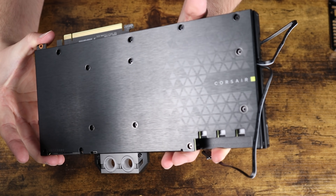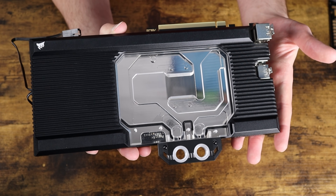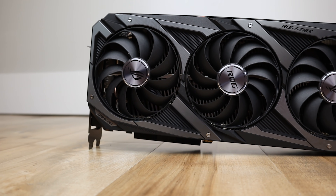If we take a look at the back of the GPU cooler, while it does have some thermal pads that make contact with the VRM on the RTX 3090, the problem is what we're looking at here is just a simple metal piece — it's really not going to be very effective at dissipating all that heat. The GDDR6X on the RTX 3090 can get very hot because it's right on top of more memory that could be soaking in that heat, and if all that heat isn't extracted from the GPU and the front memory fast enough, the GDDR6X modules actually run hotter and draw more power than regular GDDR6. Despite being designed to be more power-efficient, GDDR6X is blasting well past that efficiency curve because it's clocked so much higher. So when you take this little tiny metal cooler on the back, which has no active cooling whatsoever and is just making contact with the chips, it's simply not going to do a good enough job of keeping that memory cool.